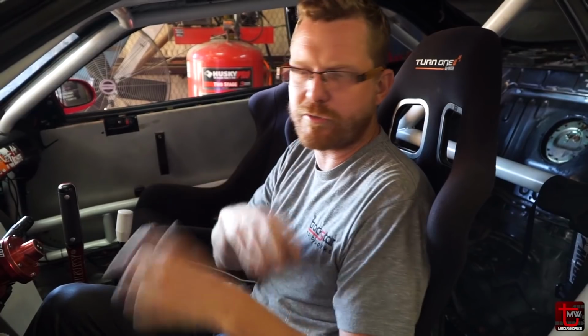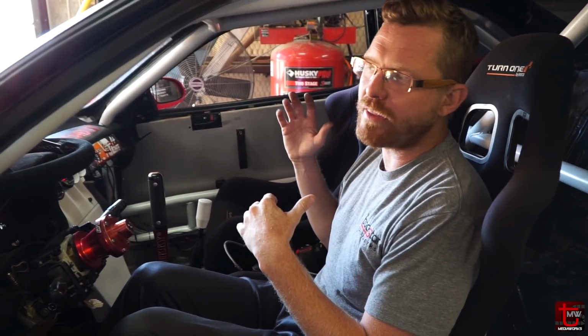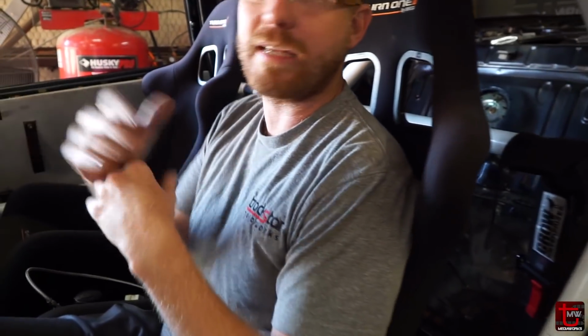It was giving us problems starting up, and I wasn't sure if I needed to change something in the tune, because we were making so many changes and diagnosing so many things. You don't want to go refining something that may not even be right. We knew that fuel pressure wasn't building on the pressure regulator, so I was adding fuel in the tune, even though the really right thing was to get that regulator building pressure again. Once we got that working, I had to pull this wall of fuel away, and that's when we saw the boost level escalating all the way to infinity.